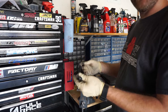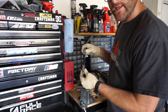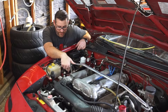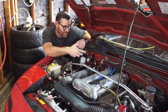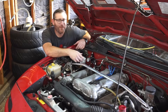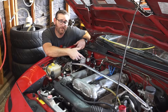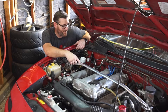There's our fuel rail to fuel regulator line, and our fuel pressure to fuel rail line. We have our fuel pressure regulator, gauge, fuel rail line, and return line all connected, so now we just need to fire it up. We'll set the base pressure by removing the vacuum line and setting it to about 45 psi, and you should see about 35 psi with vacuum attached. After that, we'll tune it lean or rich based on what we see from the AEM wideband.